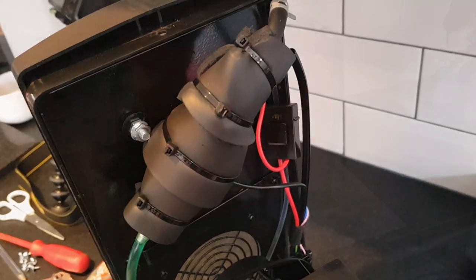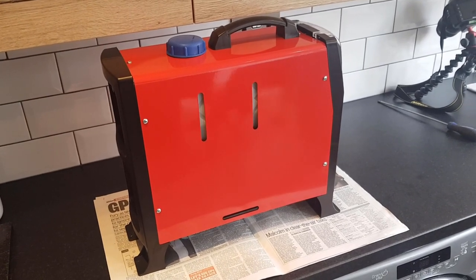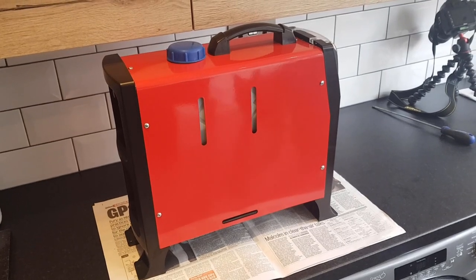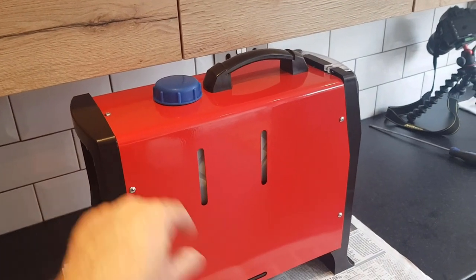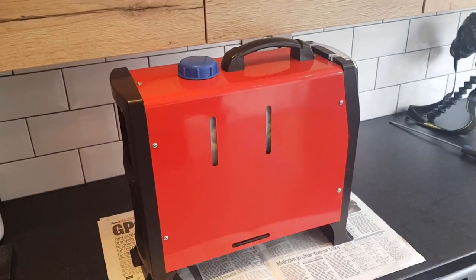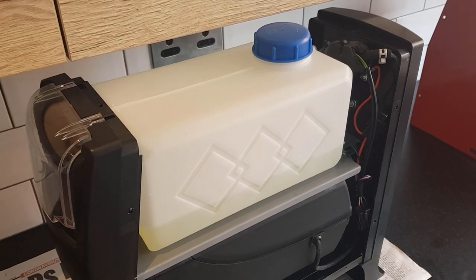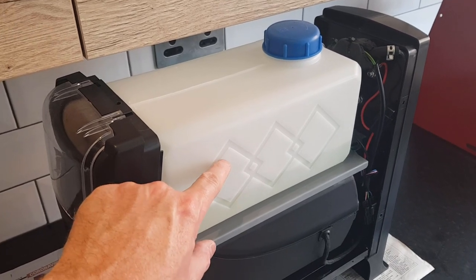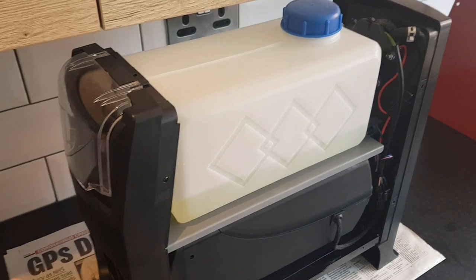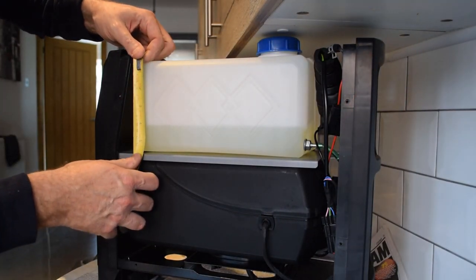Insulating the pump has worked fine — a little bit of noise reduction — but we want more. So we're going to have a look at putting some noise insulation inside the casing and see what room we've got at the top between the case and the tank. We're estimating we've got about five millimeters to play with between the side of the plastic fuel container and the metal cabinet sheet. The insulation material is also about five millimeters, so we'll see how that goes. It measures about 13 centimeters...